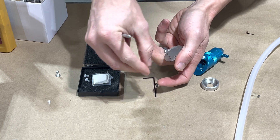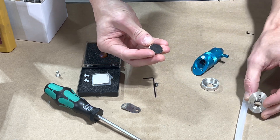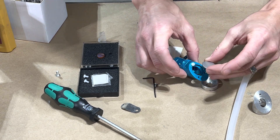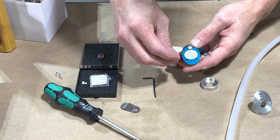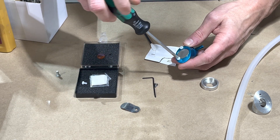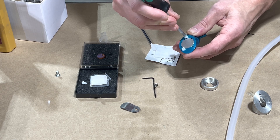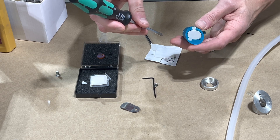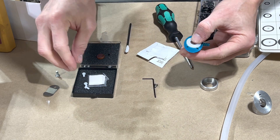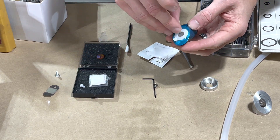You can also use that little metal piece that was just removed — just be real careful not to touch the front of the mirror. I noticed a couple of spots on it so I cleaned it off-camera. It just drops right into the little slot, then put the plastic screws back in. I went ahead and screwed them all the way in, but the mirror was still a little loose, so I added a small plastic washer on top. A metal washer works too, but I went with plastic to match the white screws, and that held it perfectly.